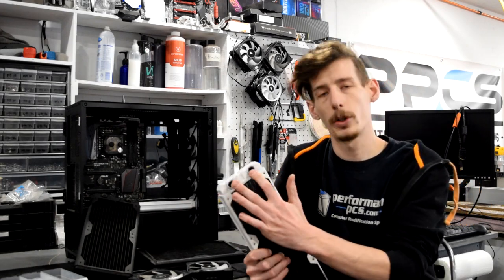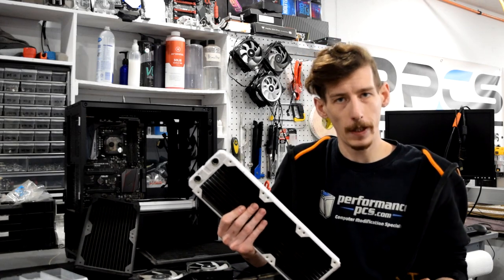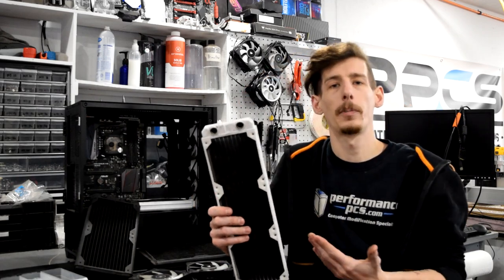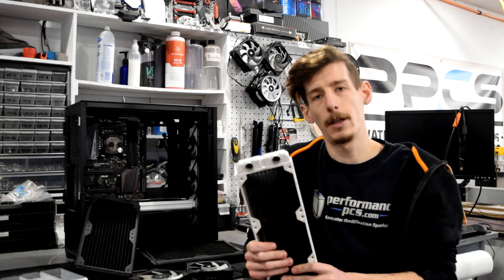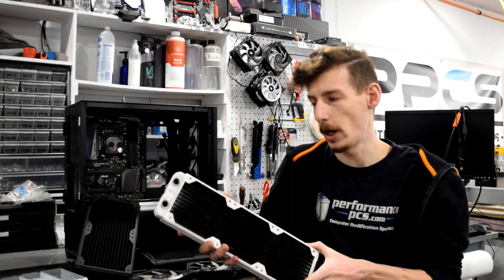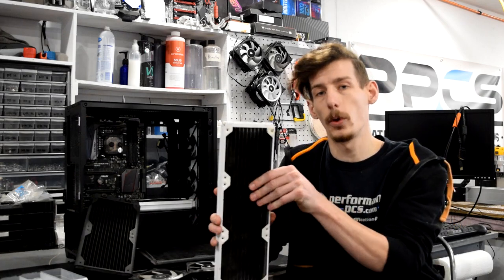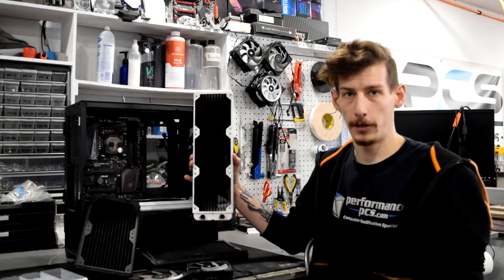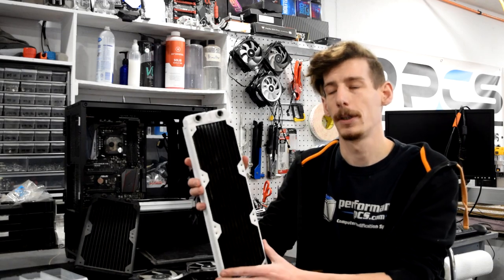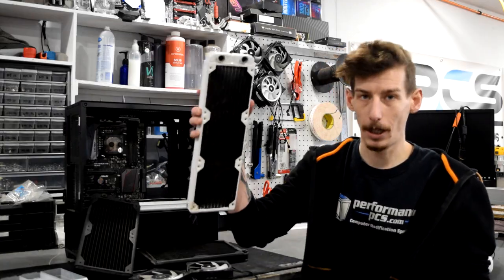With the U-flow both ports are gonna be on one end, much like you'll see with your AIO liquid cooling loops, and there has been a lot of debate about whether you should have the ports down or up. For custom liquid cooling it's not quite the same problem as with AIOs because there is no pump housed inside that could go dry. However, when it comes to draining your loop, having the ports down or near the bottom of your case will help your U-flow radiators drain much better — if you have the ports up it can be quite challenging to get all the liquid out without having to tip the case a lot.